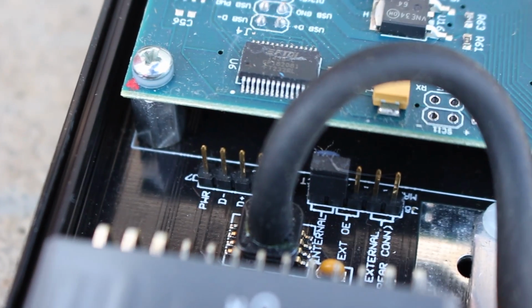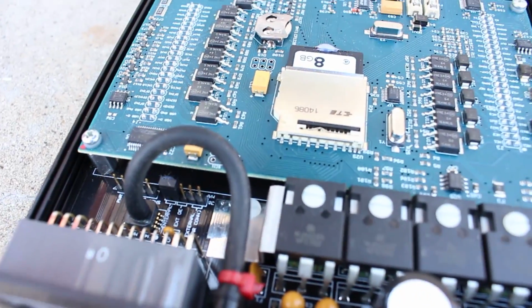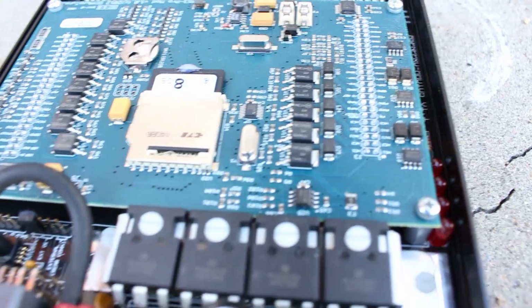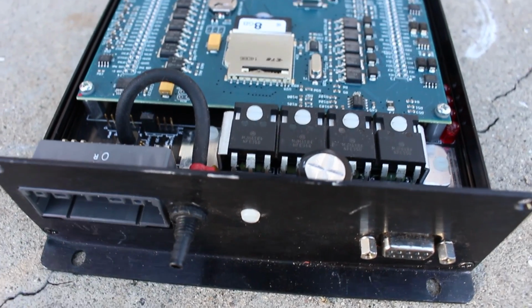So all I'm really looking for is to see if any aftermarket jumpers were added on some of these pins, which O2 sensor it's set up to read from, and all this information can be found out in the installation instructions. I have specific installation instructions for an NB linked in the description below. Looks like everything on this board is untouched, so this MS is ready to install.